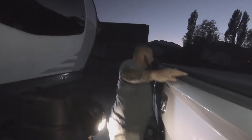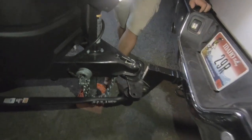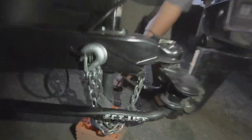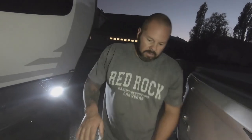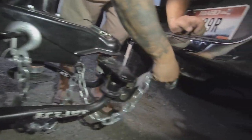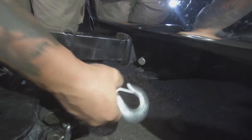So now we're ready to lower this all the way down and get these blocks out. We just hold the button down until our leg is all the way up as high as it'll go and it stops. As you can see, the weight is now off the blocks and on the truck. Blocks out of the way — I just put those in the bin over here. Then I remove the chains from their convenient little holder and pop them into place. I put them this way because it seems like they'll be a lot harder to come unhooked than if you were to put them the other way, so I always hook them that way.